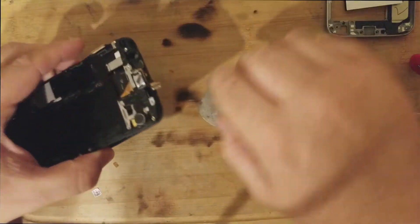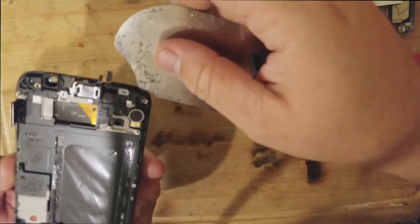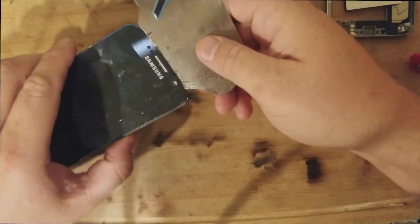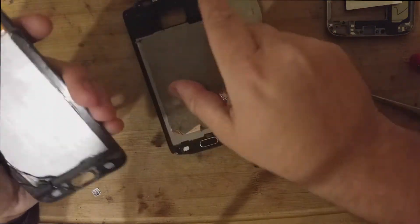Let's do it on this side here again. Not too far — make sure the blade's in there just enough though. And then we're going to get under the screen there. Just where the cable is, is where you put your finger, and we just twist. That should come right up. Now this part you just slice up here with your iFlex tool — just about right there as you can see — and then just twist right off. And boom, you got your good display out.